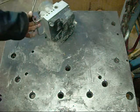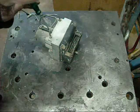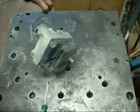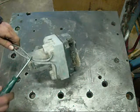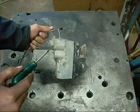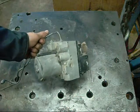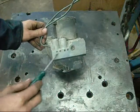So what I am going to be doing is pulling it to bits. I don't know what it came out of — it has part numbers all over it but no real details on what it came out of. It is made by Bosch in Germany. That is the main electrical connector up here. We have MC1 and MC2 there, which is master cylinder. Left front, right front. And there should be rear brakes — rear brakes operate off one tube on this vehicle. There is only one outlet, probably at the rear of the car, and obviously independent front brakes, left and right front.